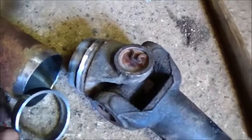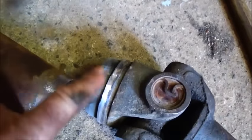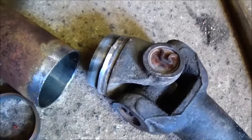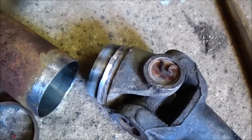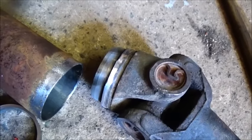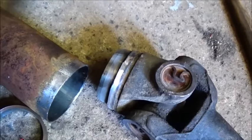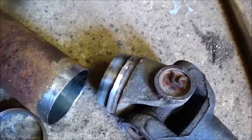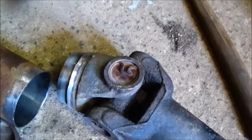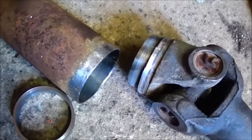Okay folks, here's our finished ring. Got the driveshaft cleaned up and ready to put together. We can go ahead and knock this all together — it's not real tight, but it's going to be tight enough, it'll stay no problem. We're going to get this together and then put it in the truck, but we've still got to get the brakes unlocked on the back so we can turn the wheels to dial indicate it in. The center joint is way bigger than that rear joint, so I don't think we've got to worry about ever breaking that one.